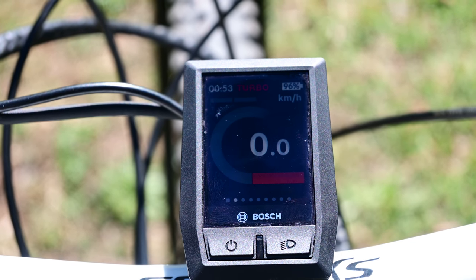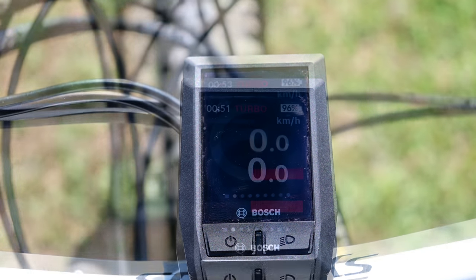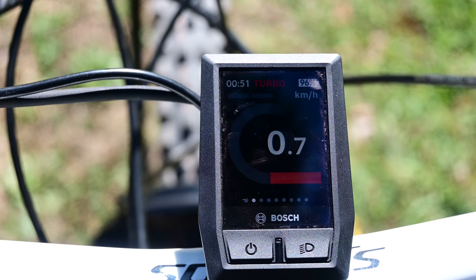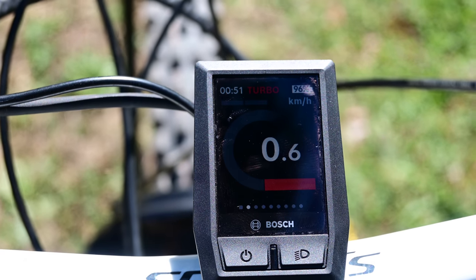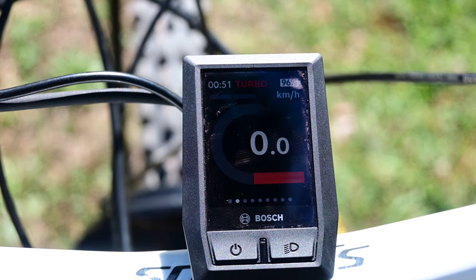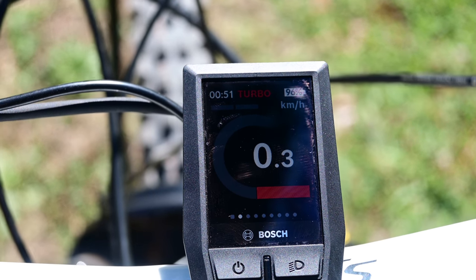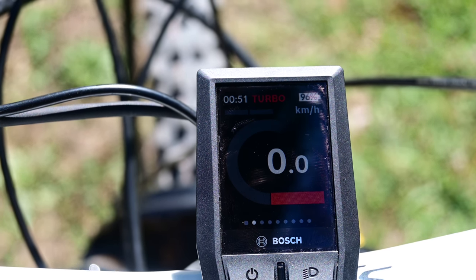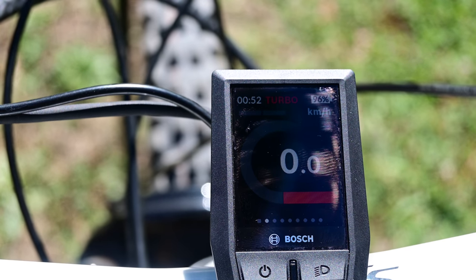We've just taken it for a quick ride to show you how the countdown works. It takes about 30 to 60 seconds for the countdown to start, and then as you can see on the screen it will count down — 0.9, 0.8 — it can start from a higher number and flicker some random speeds, that's all normal. At the end you can turn off the bike and you won't get those Bosch 504 errors. It's important that you let the bike complete this countdown whenever you ride it. The best way moving forward once you've chipped your bike is just not to turn it off — let it turn itself off when it times out, which takes around 10 minutes if the bike's sitting idle. It doesn't matter if you interrupt that countdown mid-ride, it's only at the end of the ride that it's important you let it happen every time.